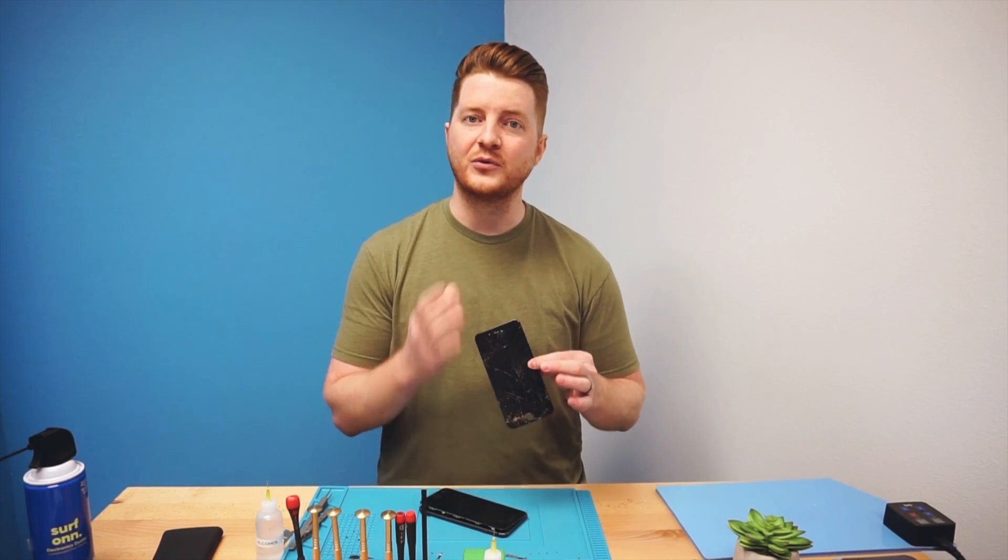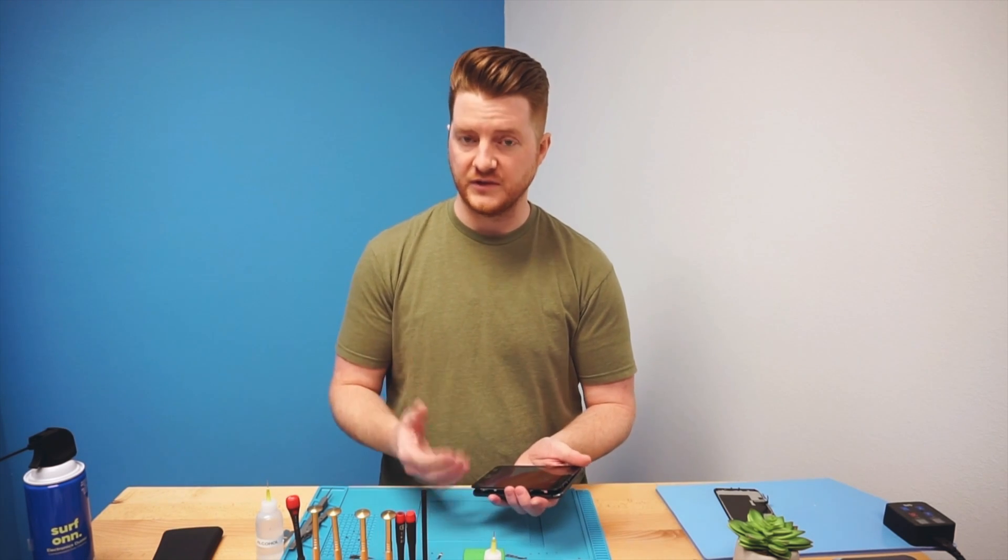Here in front of me on the bench I have an iPhone 8 Plus that we recently bought back from a customer. I just swapped out the screen on it for this particular demonstration, and I wanted to show you one of the things that sometimes happens. I see this all the time in the Facebook groups and other areas online where people talk about running through five or six screens until they find one that actually works properly with the home button. Generally on a screen repair there's a very simple explanation for this. A lot of times what you'll see happen is you'll notice that the return to home feature doesn't seem to work on the home button anymore.